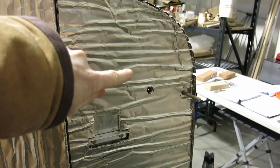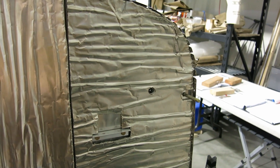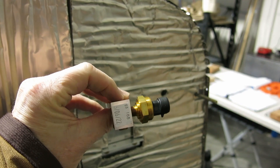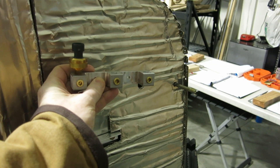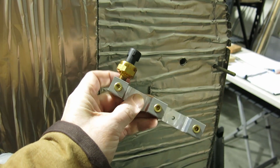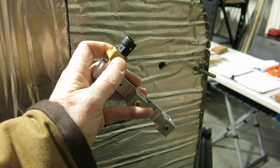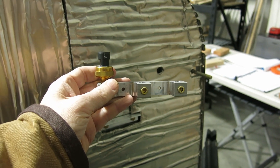We're going to be putting our sensor manifold about right here on the firewall, and I don't really want to cut a big giant hole in it to accommodate the sensor manifold. These sensors are pretty much flush with the back, so even if we did a full-size hole to match the profile, it's still going to be really tight against the firewall and could create problems — if I need to change out a sensor, I'd have to take the entire manifold off instead of just unscrewing it.